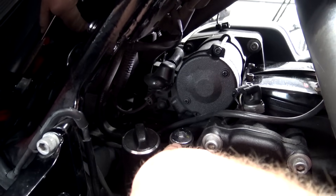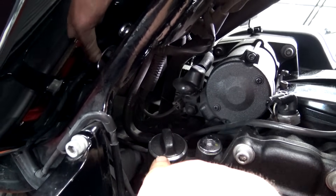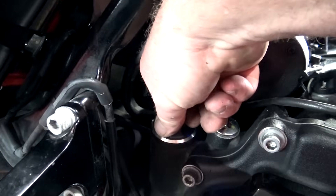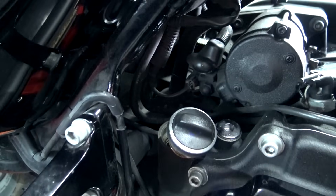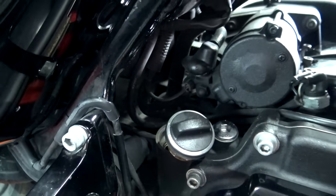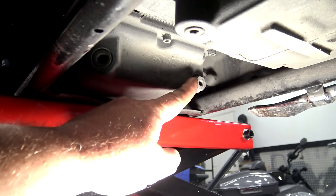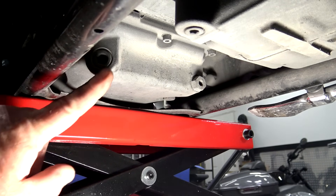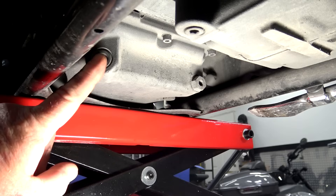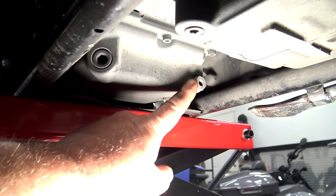Get the bike warmed up, get it upright, and slide your oil pan under the front. Right here on the back of the transmission you can see your starter, your transmission fill plug, your oil dipstick, and your oil fill hole. First thing you want to do is loosen the oil fill cap and give it some breathing room — just leave it open right like that. You're going to see two plugs; the one with the 5/8 socket is your drain plug.